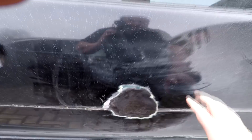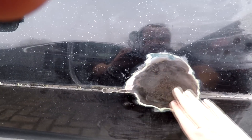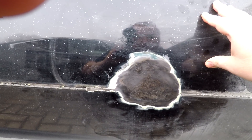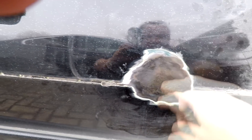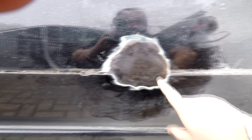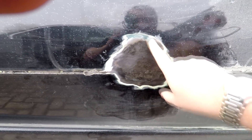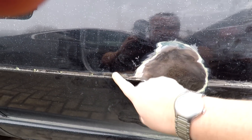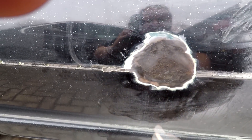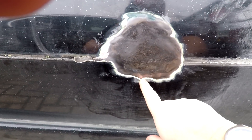Let's take a little bit of a look at what's happened there. As you can see, typical work done probably over in America — they're into the habit of actually skimming the whole doors when they do bodywork. And as you can see, this has some rust on the centre of the panel there. It looks like the whole door's actually been skimmed, so the rest of the door is pretty much sound. It's just the paintwork which we're going to be changing. This is going jet black, but as you can see, we've had to sand that down.